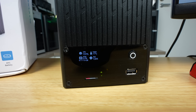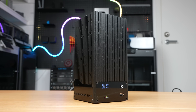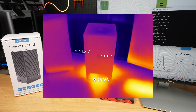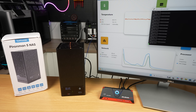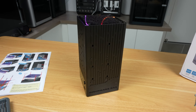As I said earlier, this is still a beta product, and SunFounder are using these tests and feedback to iron out problems before they go into production, so the final kit will likely have a better cooling solution. The outside of the case doesn't show much of a temperature increase since there is a lot of space inside the enclosure and the 90mm fan is quite generous. Results would probably vary a bit with 3.5-inch drives as these close up more of the internal volume, but there's still a lot of space for airflow, and the aluminium housing acts as a bit of a heatsink too.